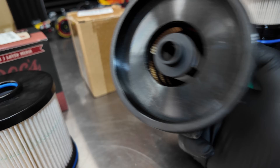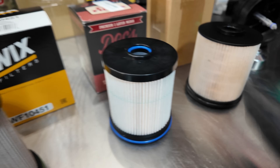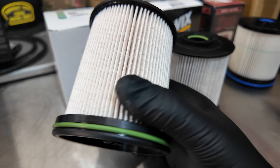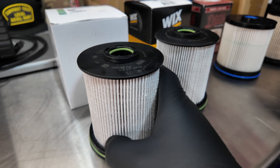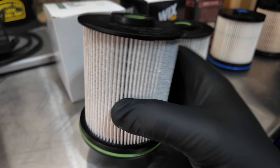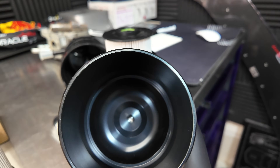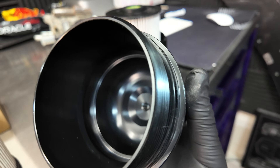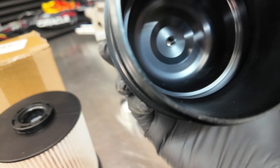So that's my warning to you: please do not run a cheap fuel filter in your Duramax diesel. I believe I got this AC Delco for about $21 and the recommended interval is about 25,000 miles if you go by the 3.0 Duramax cluster, but I go 10 to 15,000 miles max. This is just cheap insurance. And the other reason I say that is because when you take it apart, you're actually going to be able to see inside the fuel filter bowl — and if there's any contamination in there, you can know right away. It's better to know earlier than later, especially if it's going to be on your dime.